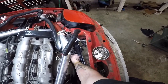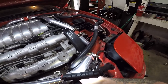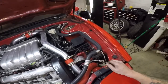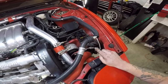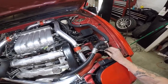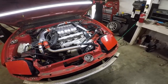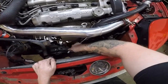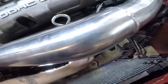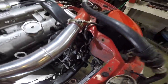You can't just pull these lines off or they'll spray refrigerant everywhere. Mine was already drained - there must have been a small leak, or someone else did it. You can test by pressing this to see if anything sprays out. If it sprays out, you gotta suck the refrigerant out with a machine. So I'm gonna leave the compressor on there for now until I can get another belt.